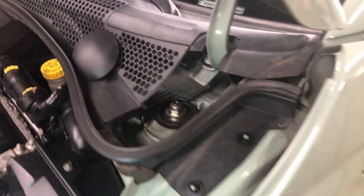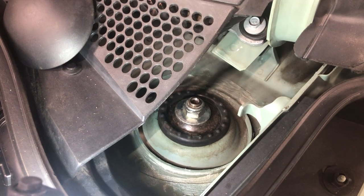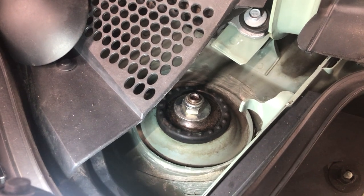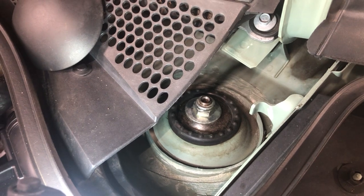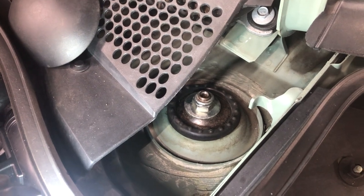The first thing from the very top is the top of the shock strut tower. As you can see, it uses a nut and bolt thread that goes through there, with a washer and a little rubber pad so it seats correctly at the top. Underneath there is a heavy rubber mounting point that ties into the top of the chassis where you see the green paint.